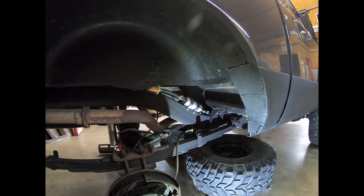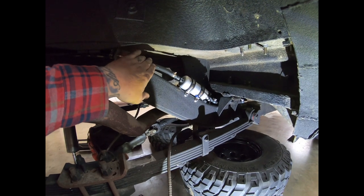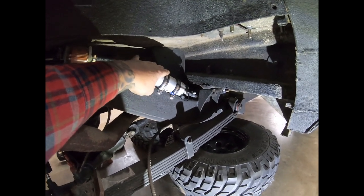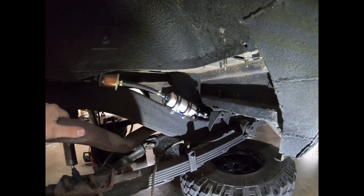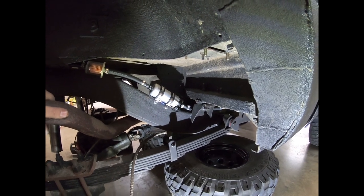Moving towards the back of the vehicle, we're moving on to the fuel system. Again, as I mentioned earlier, you have a feed and a return. Our return line is here. Obviously, here's our frame mounted fuel pump. The fuel tank does need to have a provision for a return either in the tank or in a vent hose if you possibly can.